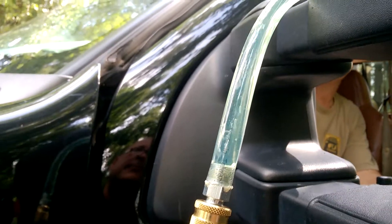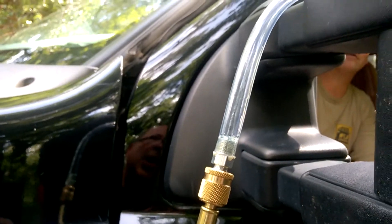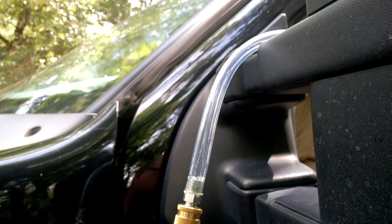All the air is out. Now all you do is turn the key on one time, so the fuel pump comes on once. There you go, then you just stop. That's all you got to do is one time. When you change your filters, you'll probably have to cycle it more than one time — you'll have to cycle it three or four times.